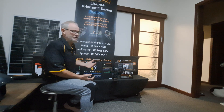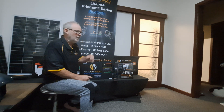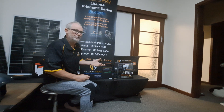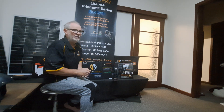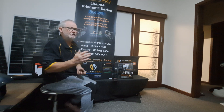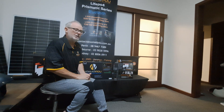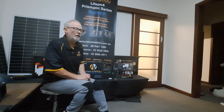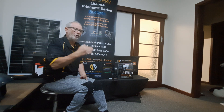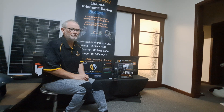You can probably run a 1500 watt inverter, but remember 100 amp is not 1500 watt — it's a bit less. Be careful and check what's the rating of your accessories. Microwaves are generally 1200 or 1100 watt; you can get them at 600–700 watt which is fine. Blenders are around 1000 watt for a Ninja, for example. Induction ovens and coffee machines can be up to 1800–2000 watt depending on type. Look at the requirements to run those accessories and make sure you're not drawing too much from the unit.